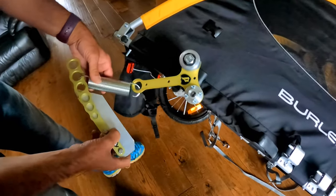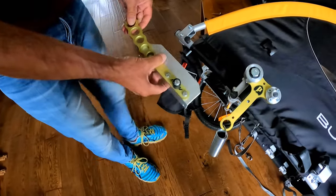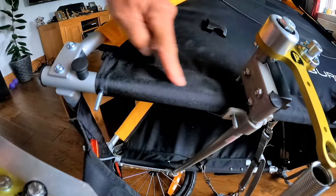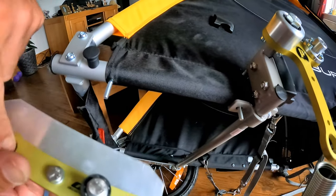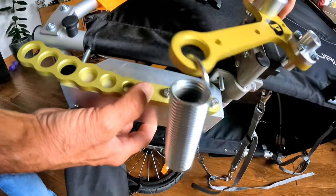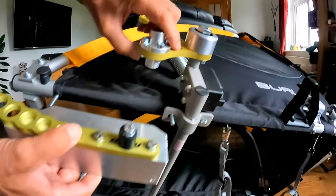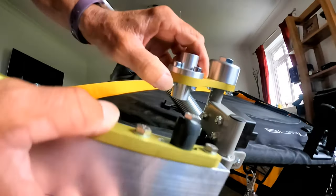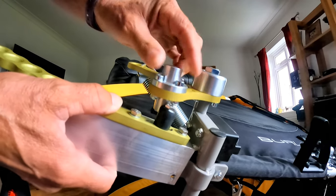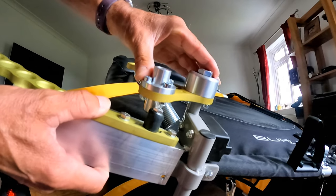So we've had to make this bracket because if you can see, it would be mounted onto this tubular frame here, this bracket, the painted bit, and it's too far away from this pivot because part of the pivot is it's got this thing here that can be used as a bump stop to stop the suspension going too far back, unloading itself and the spring falling off. And we'll show you that in a minute and it'll make a bit more sense.